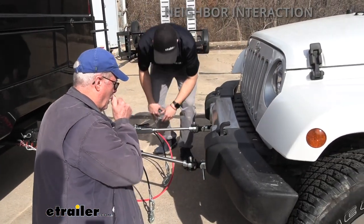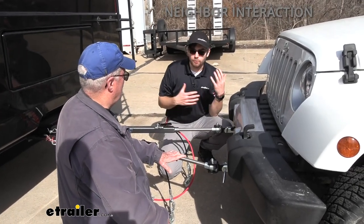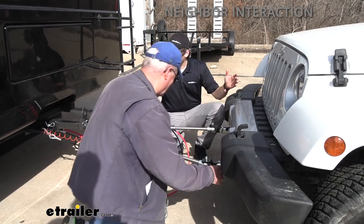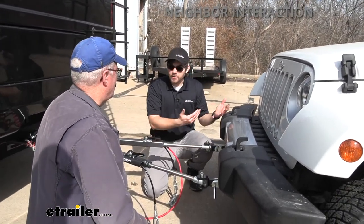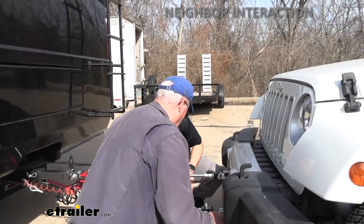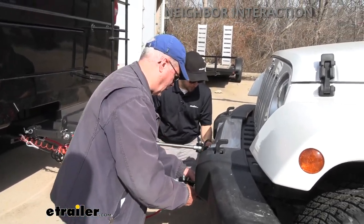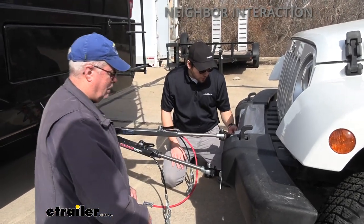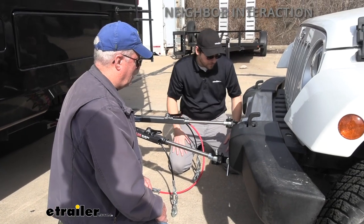One thing you always want to do when setting up your Jeep is make sure you have your emergency brake on. If you find yourself on a slight gradient like a driveway, you might get a little forgetful and then you're chasing your Jeep as it rolls. If you're having trouble getting close enough, just hop back in the Jeep, make sure your tow bar is out of the way, pull forward a little more, have someone tell you where you're at, then put the brake back on. The safety cable pin orientation doesn't really matter — wherever it's easier for you to access is the way to go.